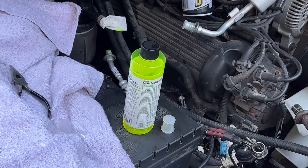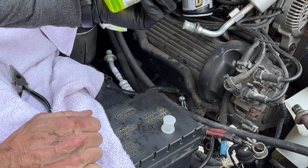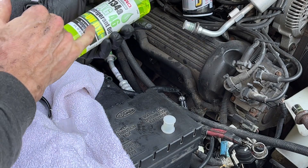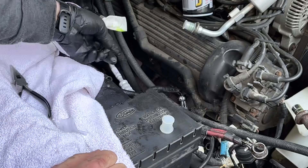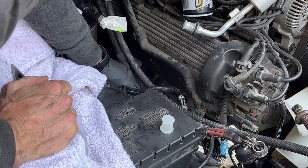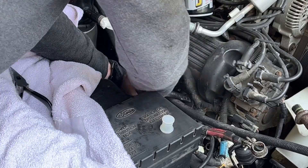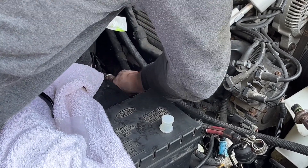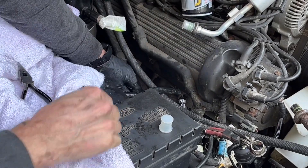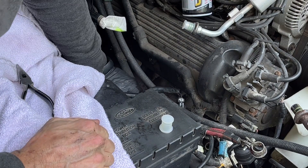When reassembling these seals, you want to use some kind of oil — this one actually has UV dye in it just in case there are more leaks, which may help find them. When putting these in, put a coating of that oil on the O-rings before you slide it in, then just pop it in and make sure that spring snaps in. You just heard that snap — give it a double check to make sure it's all the way in and that spring gets a chance to lock down on the other side of that lip.